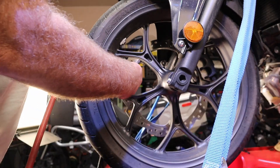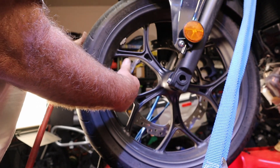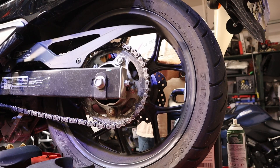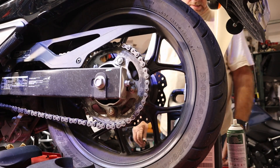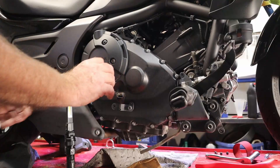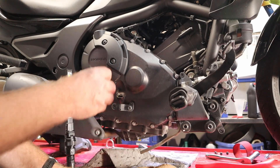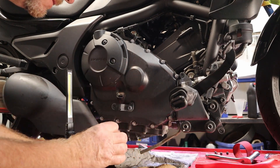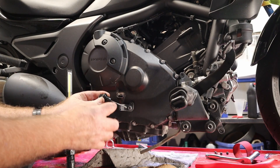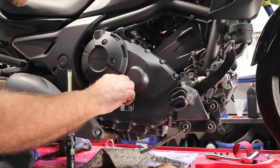36 — done on the front. Small tires didn't take a lot of air to change their pressures. We only had about 27 in the back tire. Yep, we're right on it now. Put the valve stem cap back on there. Yep, we were a little low — but there we are, right there. That'll do just fine.